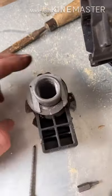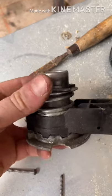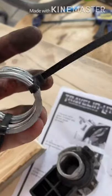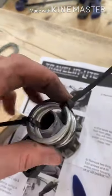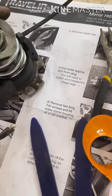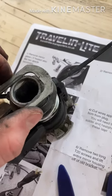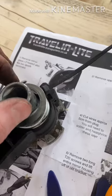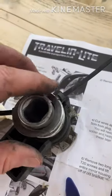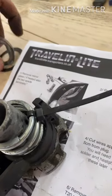Apparently you have to remove the C-clip. It looks under a lot of compression so be really careful - probably put the safety goggles on for this bit. I managed to get the spring off. I saw a tip where somebody mentioned putting zip ties on it. I managed to get one on while it was stuck. I just had the one on there. The C-clip was stuck in so I levered it out with an old chisel. There was a lot of anxiety doing that - I thought the spring was going to come up and smash me. But it came out quite smoothly because I had the zip tie on. Brilliant little tip, whoever that was.